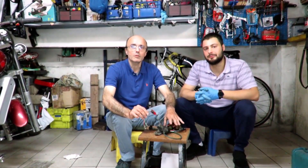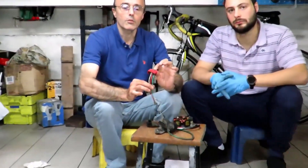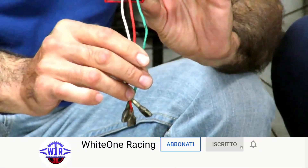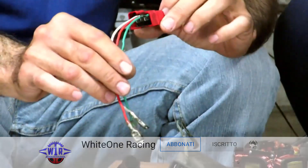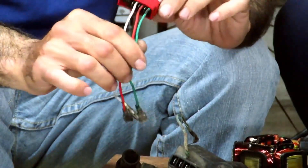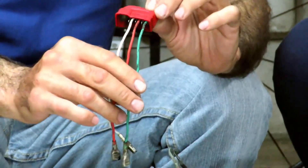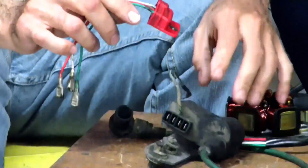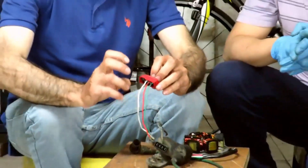We will discuss today the original Piaggio electronic system, integrated by the KYtronic module, which already has 16 preset delay curves, in order to choose the one best suited to the engine you have on your Vespa. We have chosen to show you this accessory because it is a relatively inexpensive way to optimize the original system, adapted to tuned engines with a great possibility of making it compatible with the needs of each engine.